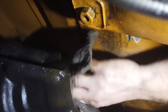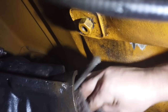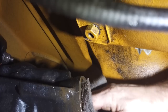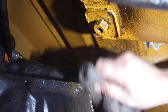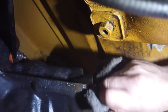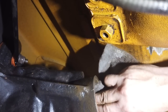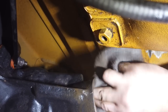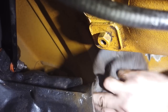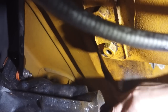You join us under the car as Richard cleans up the inner face in the casting to receive the race off Ruby, and we're going to use the bearing off Ruby. So it's a matching set. Whilst they were whiny though, we're just going to be reintroducing the whine from Ruby into this axle. If indeed it was the front that was whining, it probably was. It had a pitted gear on Ruby though, didn't it? And it had a pitted crown wheel gear. We'll show you that. Crown and pinion gears are pitted. You might be about halfway in between, a half noisy axle again.